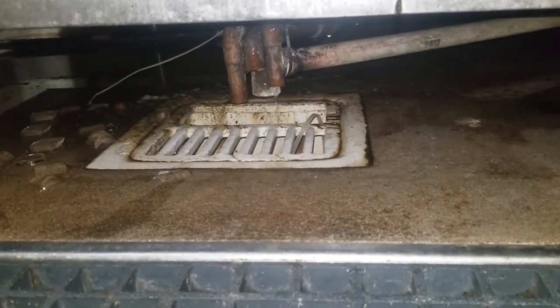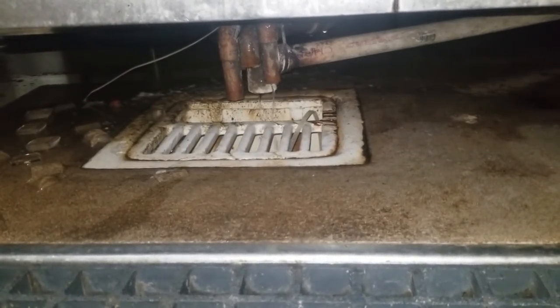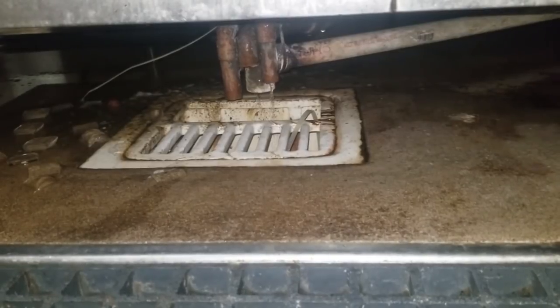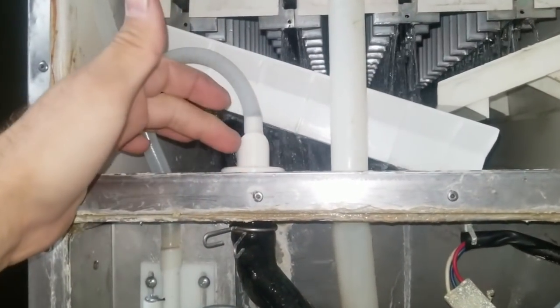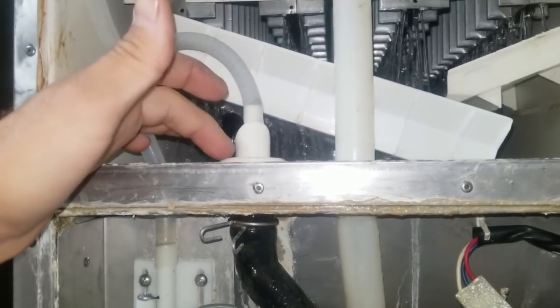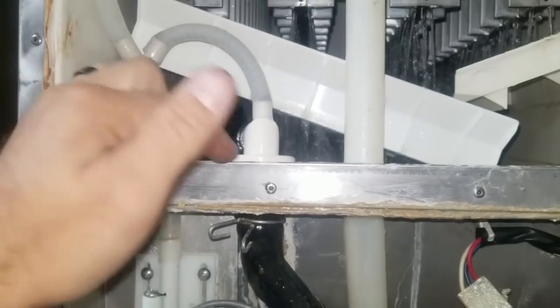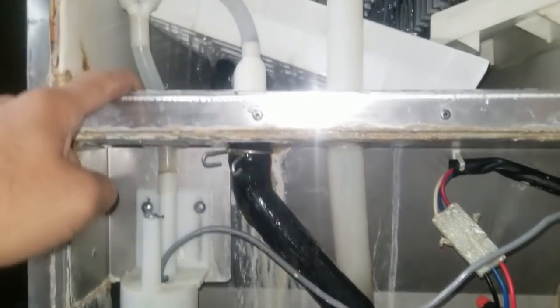The right side copper drain is leaking water while it's in freeze mode. That's an indication that there's something stuck in the pump-out screen. This is the pump-out mechanism — it has a spring and a rubber check valve. If sediment gets stuck in there, the water pump pressure will sneak past the check valve and leak out.